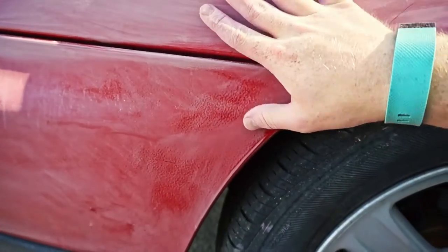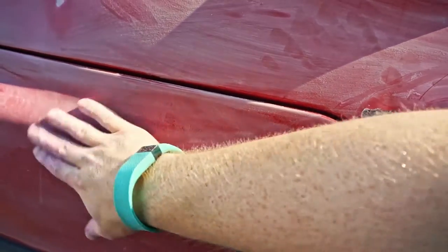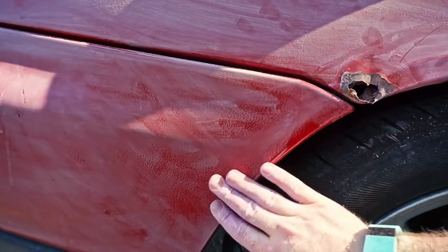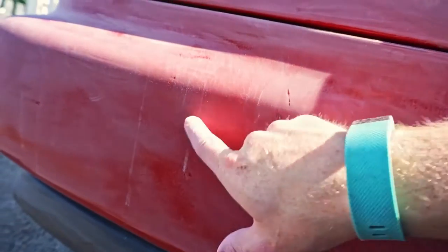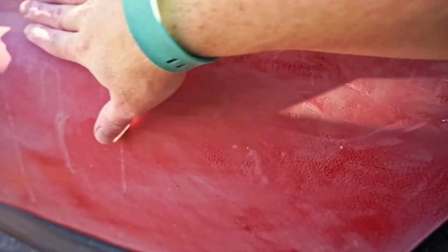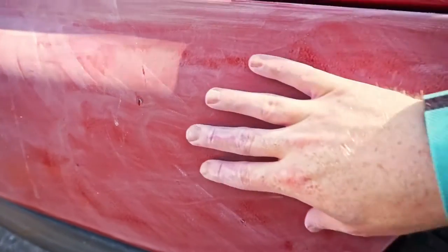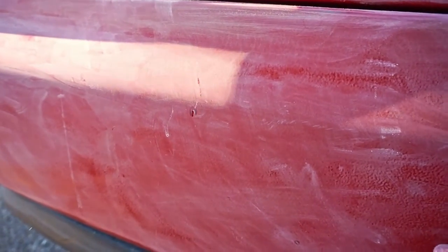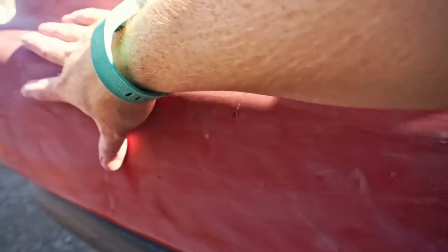Prep work for plastic is almost identical to your prep work on paint. You never want to use too harsh a sandpaper on plastic because it's softer — I try not to go lower than 320 grit on bumpers and such, because they usually don't need it. You can see some chips and scuffs in the bumper but it is a bumper, so I'm not going to worry about it too much. If someone nudges me while parallel parking I don't want to have spent a ton of time filling scratches that will just get bumped again. It's a bumper — we're going to leave it as a bumper and just color it.